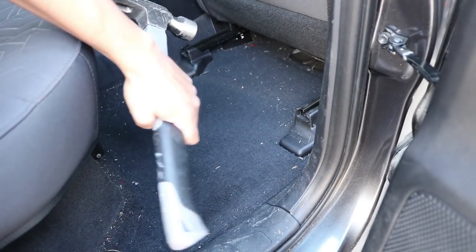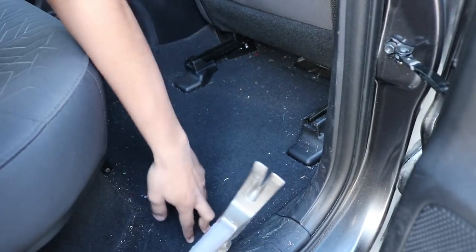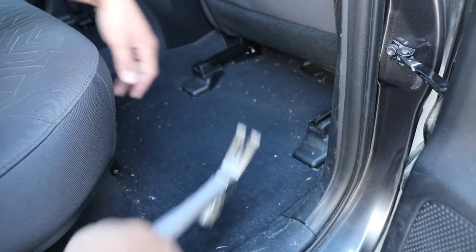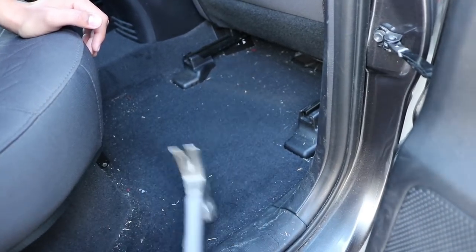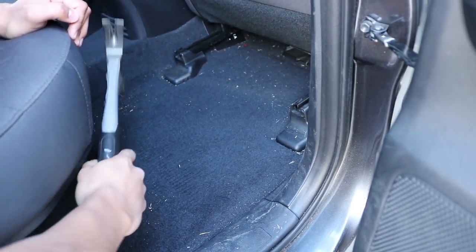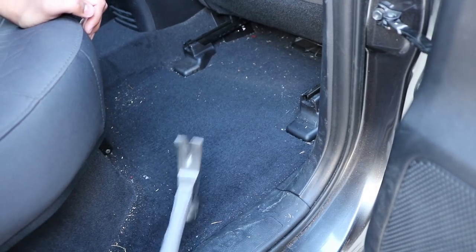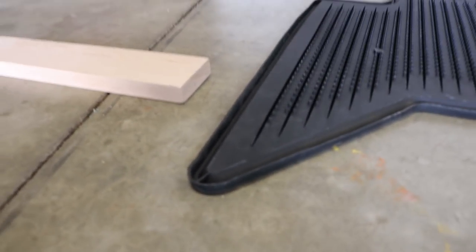So this is the part where you might need a hammer. If you don't have a hammer, it's okay — you can just use your bare hands. Pretty much what we need this for is to locate the foam padding underneath the carpet, because there is bare metal and there is foam padding. I know it's going to be kind of hard to capture on camera, but you can feel the padding all around this edge here, and if I move towards the middle you can hear that — that's bare metal. You do not want to put the clips there because they will break. So I'm going to go ahead and put mine around this section here, mark my floor mat, and do the same for the opposite side as well.